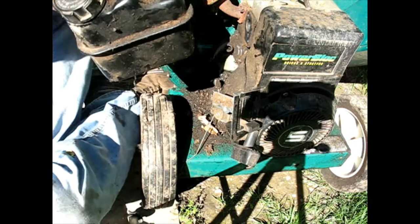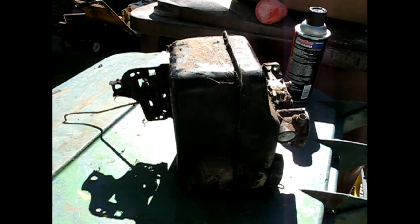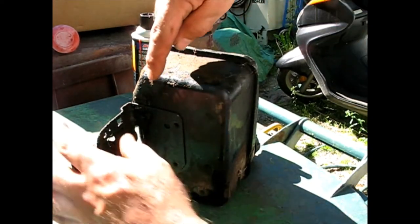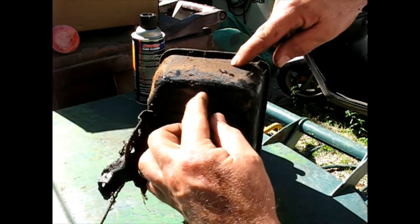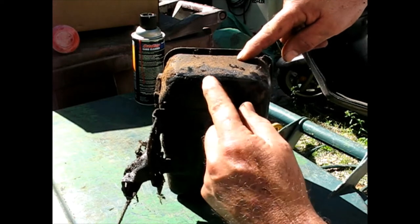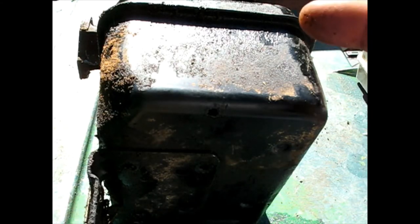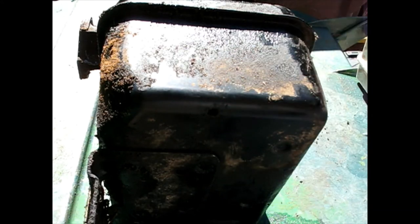I think the tank is leaking. Yes, it is — that's not good. Now I know why it didn't have any old fuel in it — because it won't hold fuel at all. Right there is a rust hole. That is the problem when water gets in there. The rest of the tank is mint, but there is a hole right in the tank. That's disappointing. The more you touch it, the more that hole just caves in because all the metal around it is real thin — it's not just the hole you see, it's thinned out all around it. Sealant might be an option for this one.